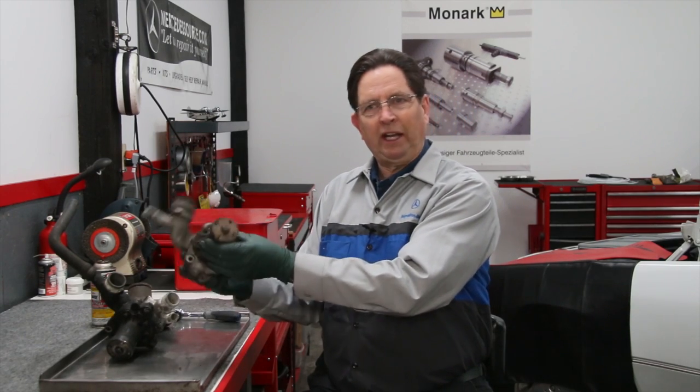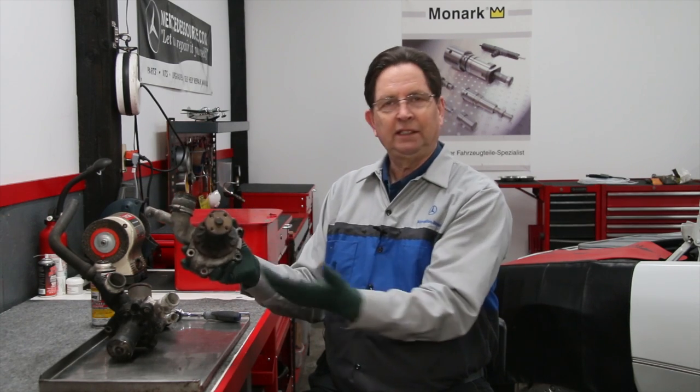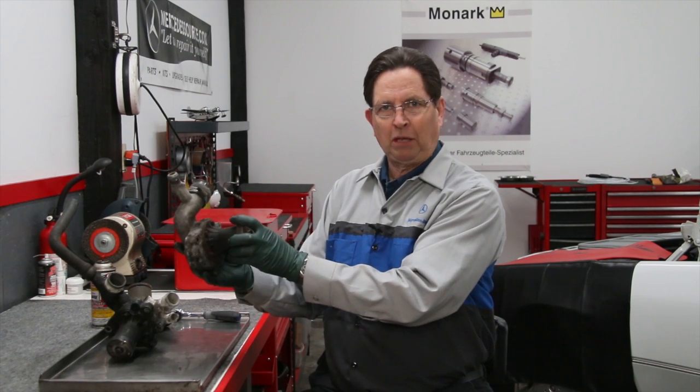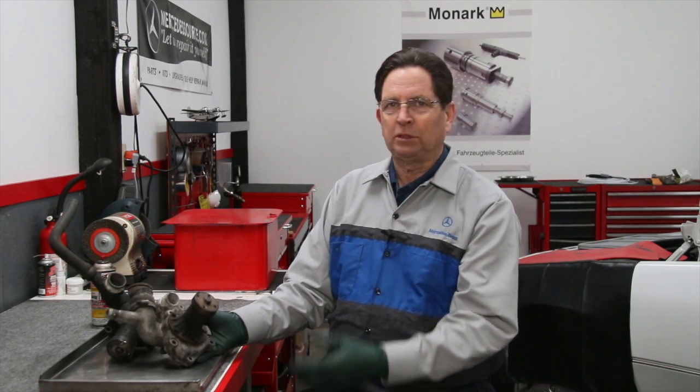This is the water pump right here. Typical water pump from gas and diesel. It's mounted to an aluminum housing, and this aluminum housing is mounted to the block, and this housing helps to circulate water through the engine. The problems come in 2 or 3 areas. Number one, water pumps wear out. It's a common wear item. It might be 100,000 to 120,000 miles. Seems like you're going to have to replace the water pump.